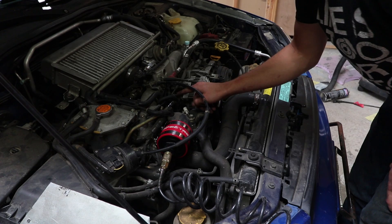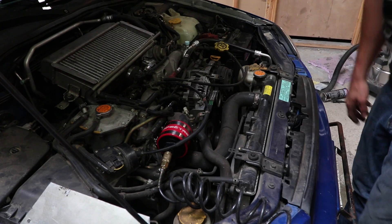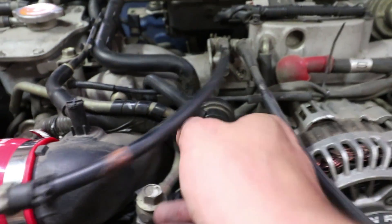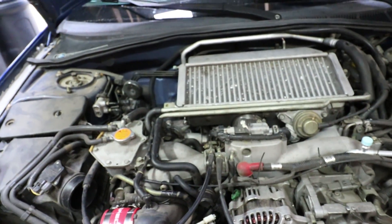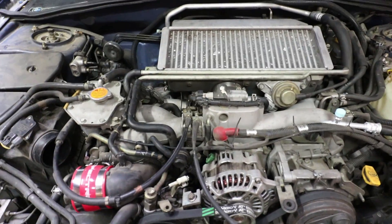There it is — whatever this thing is. So now I know my problem. It's this guy — my EVAP purge valve solenoid — that's giving me problems. It's thirty bucks at the dealer; I just called up my buddy over there. I'm not sure if that's going to fix my boost leak issues entirely, but it's definitely an issue because it sounds like a duck call whenever I'm driving. May as well fix the problems I know are problems. If that fixes it, I might just have to adjust the wastegate arm to solve my under-boosting problem.